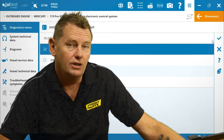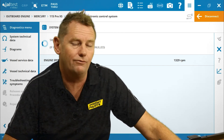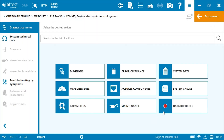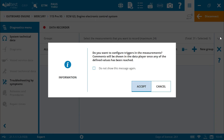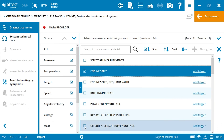From here, we can start to look at other testing functions — actuate components. Let's fire fuel injectors, ignition systems — all sorts of different components can be run up and tested to ensure they're operating as per the manufacturer's specifications. For even deeper diagnostics, we have a data recording function. You can set this up, go and take the engine for a run, and when a fault's present, you can go back and play back that engine ECM data to find what sensor is causing the fault. Again, giving you quick, cost-effective diagnostics and repairs.